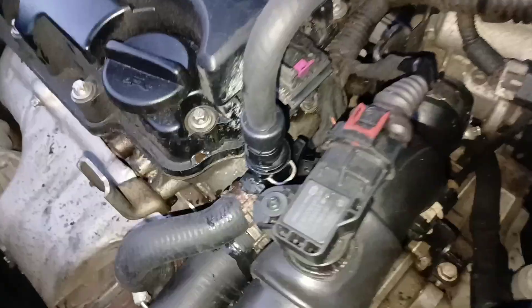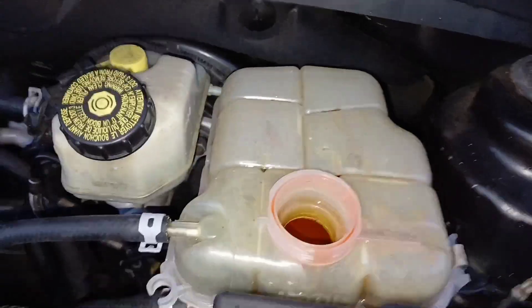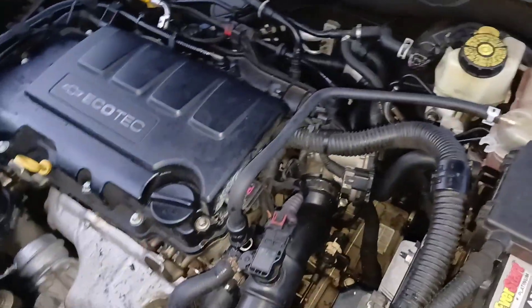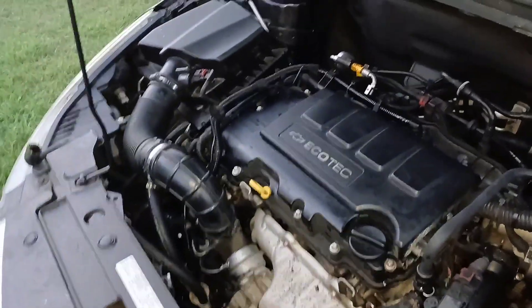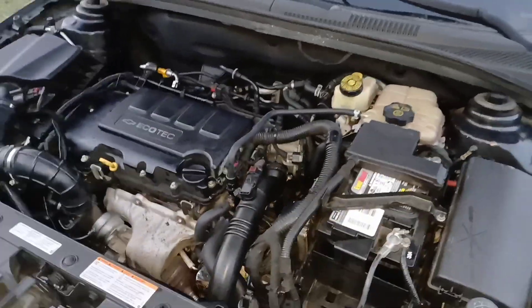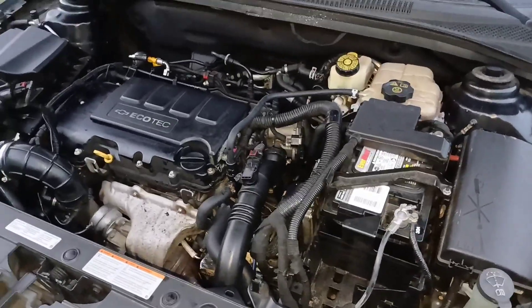You can see it's a little wet down there — as soon as coolant started to come out, I popped the hose back on and now we can finish filling from the top. It's nice and filled now, so that's pretty much it. All the hoses are changed and the coolant is filled back up. That's how you change all of the cooling hoses on a 2014 Chevy Cruze — we did them all except for the upper radiator hose and the upper heater core hose.